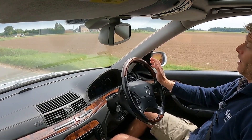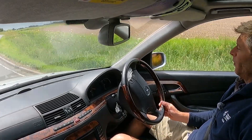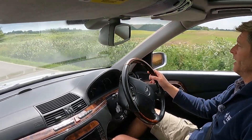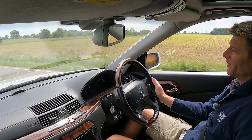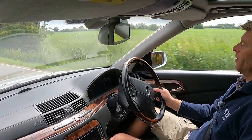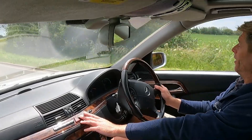I had a central locking issue where the fob didn't seem to unlock the doors. It did immediately after a journey but seemed to fail if you left the car standing for a while. I thought it could be battery drain, and it did seem better when I kept the battery on trickle charge. But then it just sporadically happens - it'll work some days and not others. I checked the infrared is working and the battery is fine. I wondered if it might be the PSE pump - I believe it's the same system that does the soft-close doors that also does the central locking.